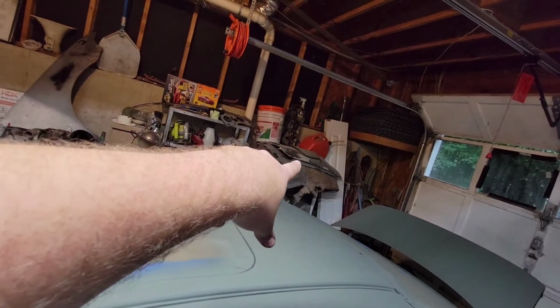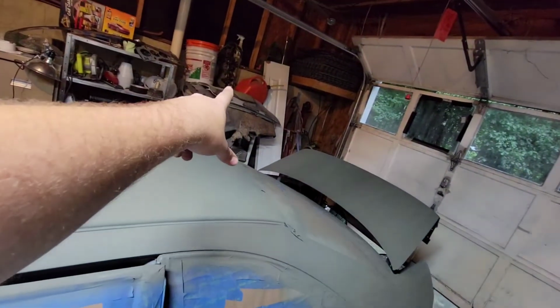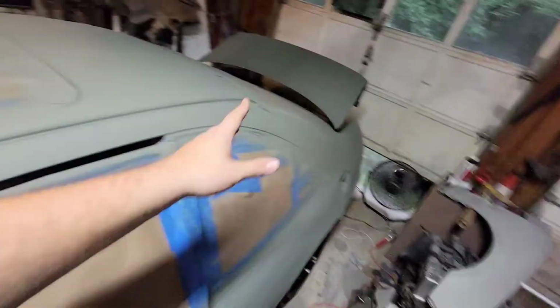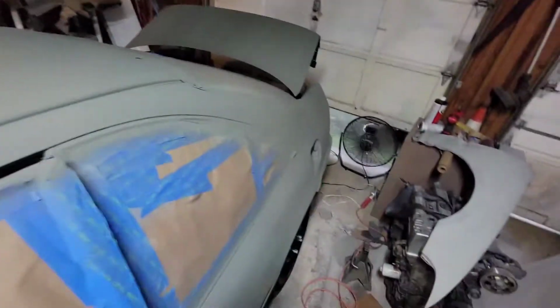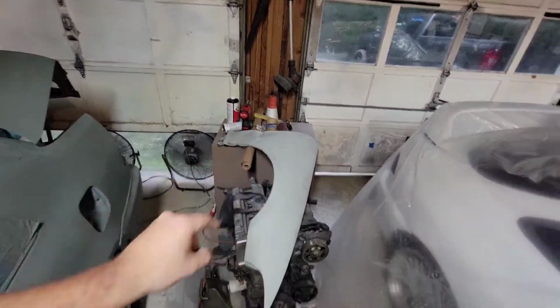This fender is right there. We're going to go ahead and sand that as well, while we're sanding that. We're just going to go over that with the DA, which is there with I think like a 220, 320, something in that area. And we're going to go over this whole fender as well, and then we're going to tackle that body work we showed before.